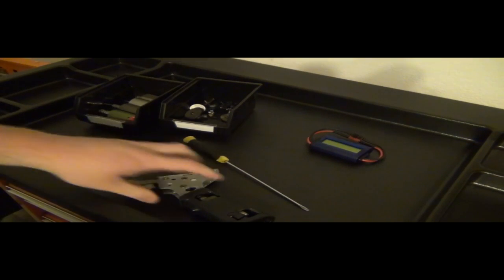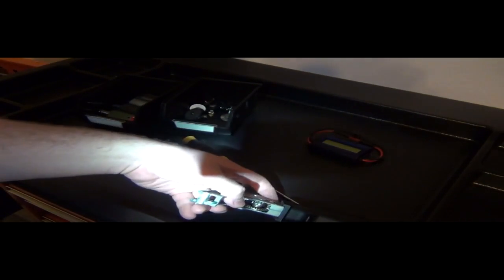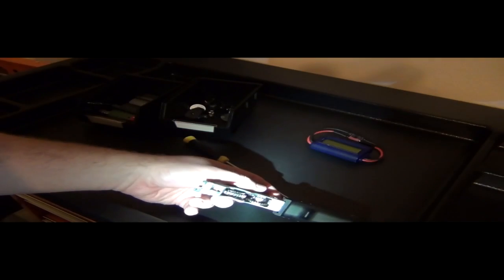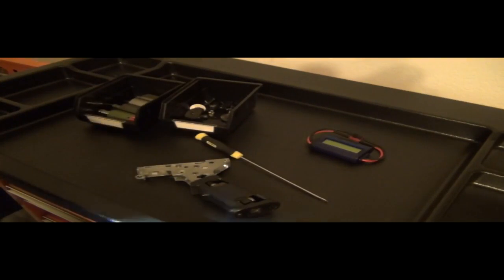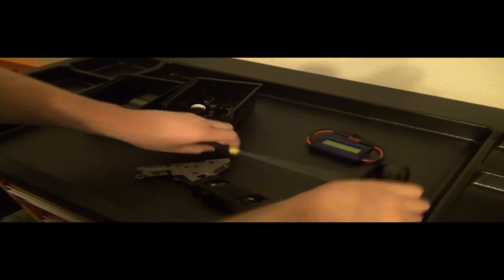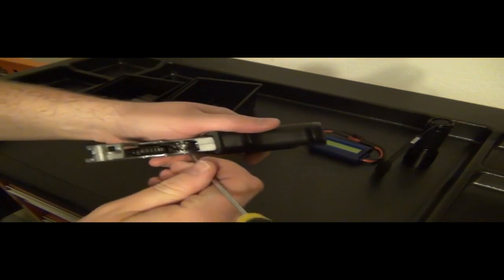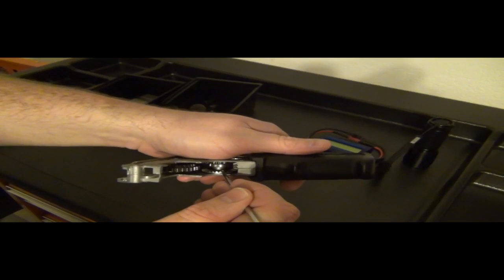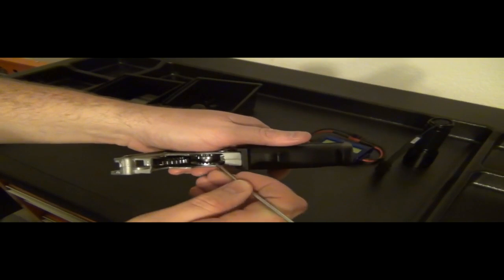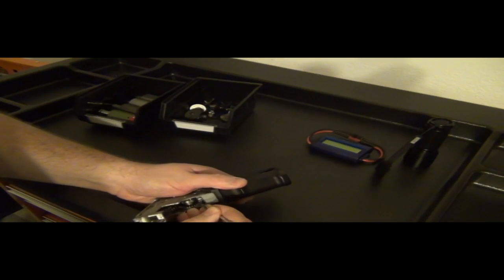These lights help out the situation. So we can see here, it's a very bright light. Okay, so right there you can see bevel to pinion is really close. Now how do I know exactly that I have bevel to pinion? There's two things that I actually do here. One is I do a test with teeth to teeth movement, and you can see the teeth to teeth movement is really slight. And two, I spin this gear right here. So I actually rotate it and feel the resistance.